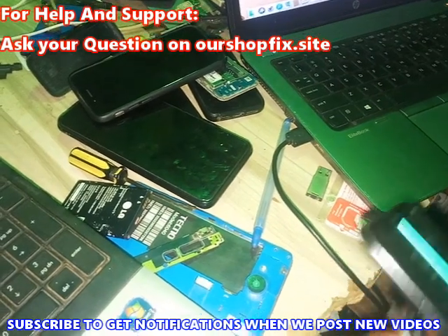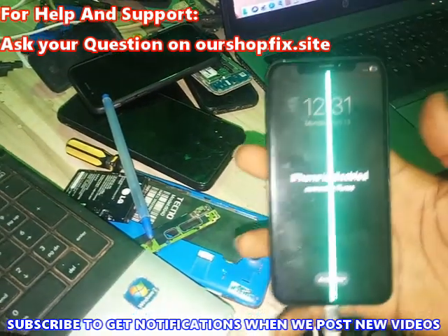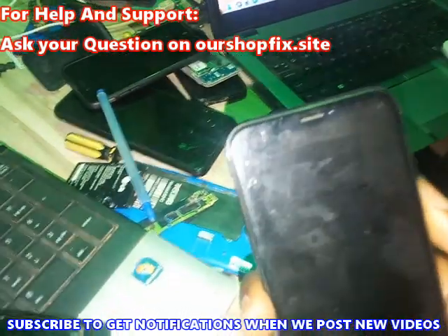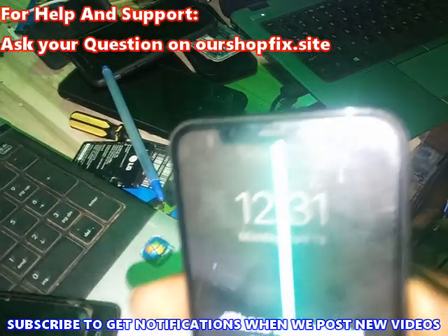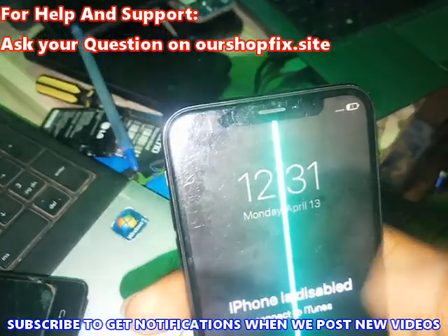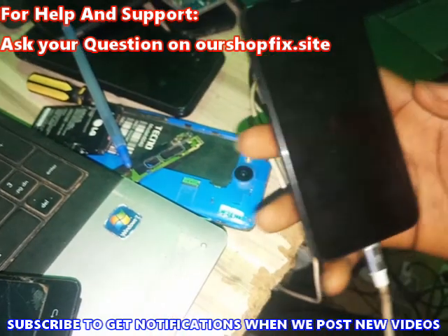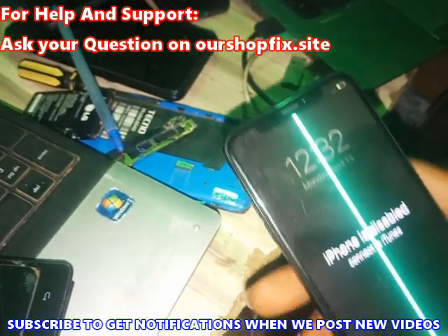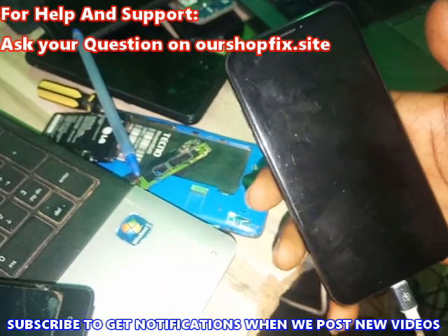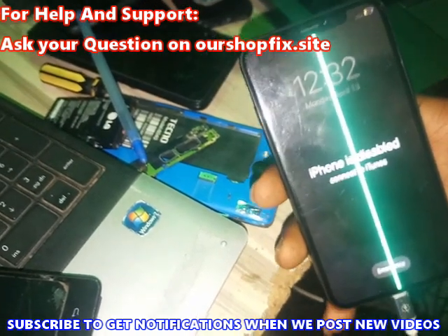The reason why you've been getting error 20 is this: when you plug your device to a PC, the phone doesn't show the charging sign because it is waiting for you to input your passcode to verify the USB before the system would recognize the phone. After running checkra1n and the script runs on the screen, it automatically boots the device to the normal screen to complete the jailbreak.